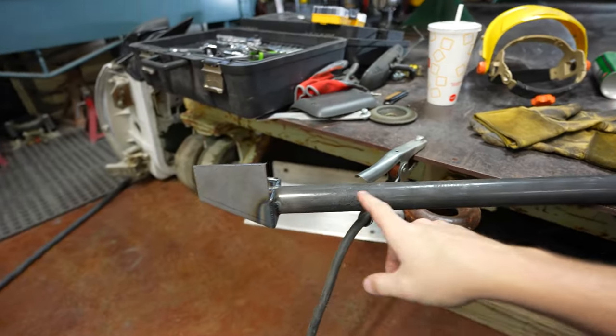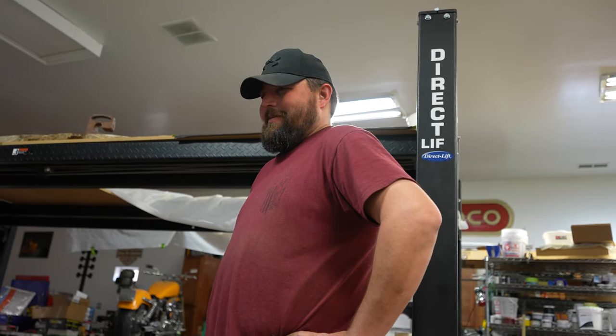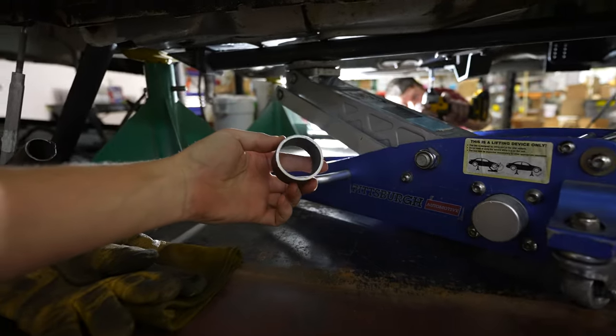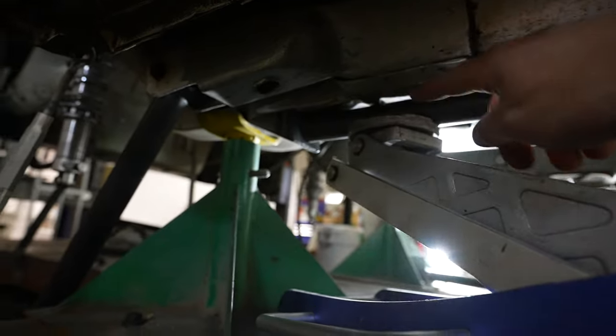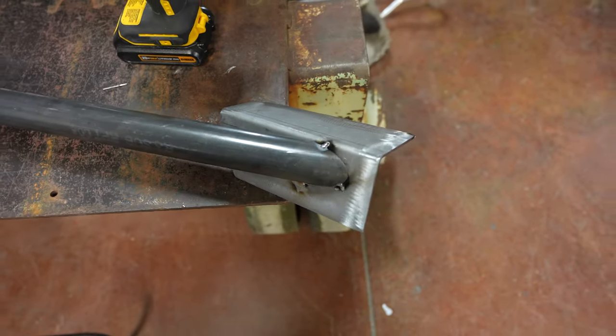Jumped over from yesterday — a couple hours in yesterday — and Alex showed up today, so we'll put in a few more hours trying to get these braces done. Working on the passenger side now — I kind of got it set up in here, still have a gap here, touching here and here on the floor, so I'm going to take my little round piece and clearance it. Otherwise up towards the front we'll have no issues whatsoever. Clearanced it a little bit here and there, now that fits tight — going to weld that up there, get this piece tacked up, and the passenger side is tacked together.